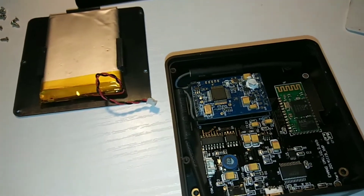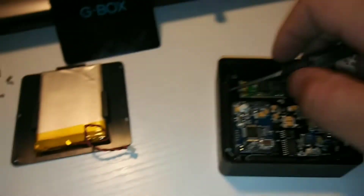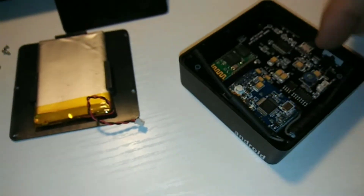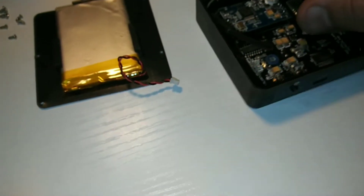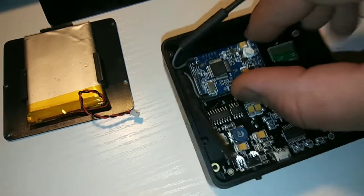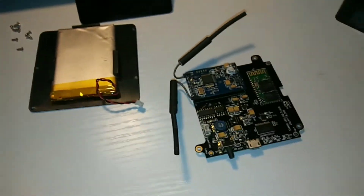I have a feeling we're going to. So basically all you do is just pop this antenna out — just like that. And then when you remove the board, make sure you pull up and out. That way the power button can come out loosely. And then you've got the entire board in your hands.